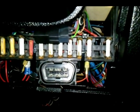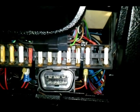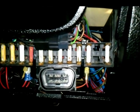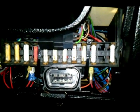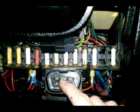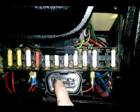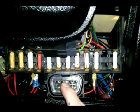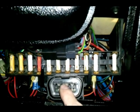I've only connected it to read the engine ECU. I can't read ABS because this car doesn't have ABS, and it doesn't have airbags. The first two wires were pin 4 and pin 5 — I joined them together and they are both grounded to earth. Pin 4 is a chassis earth, pin 5 is a signal earth. A lot of diagnostic equipment uses pin 5 to earth the machine; you can join these both together and connect them to the chassis earth.